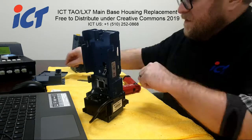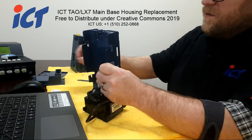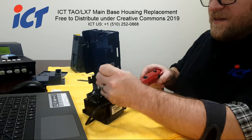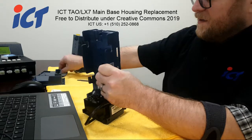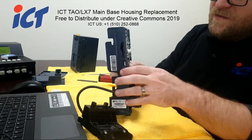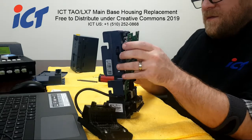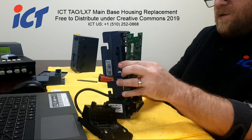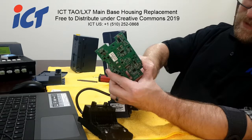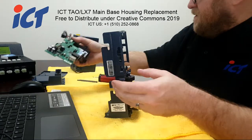And remember, since this is broken in half, once you do get these middle screws, things will start flopping around. So as you're removing this last screw at the bottom, just kind of hold everything in place. Go ahead and slide out your sensor housing and reach in and unplug your motor housing flat cable, stacker motor, and pull out your LED harness and set that whole assembly off to the side.